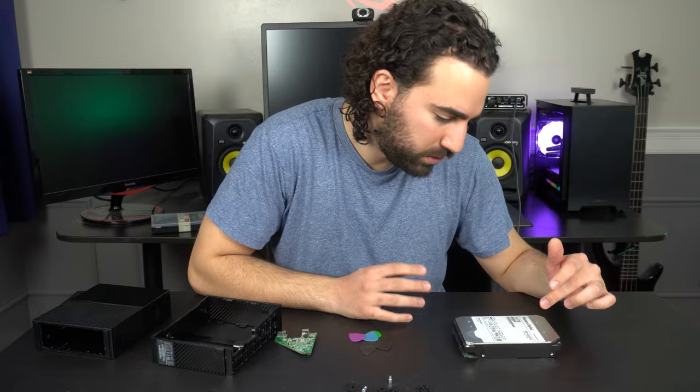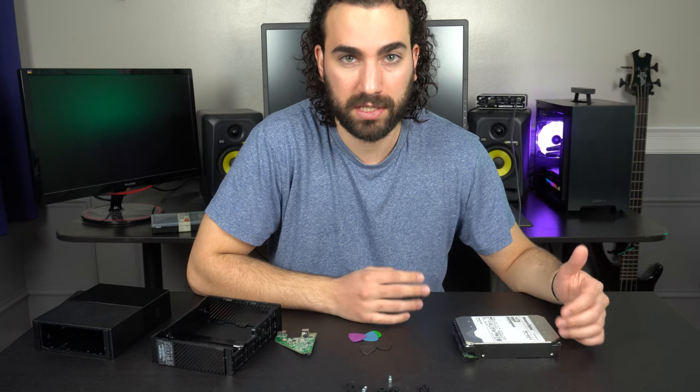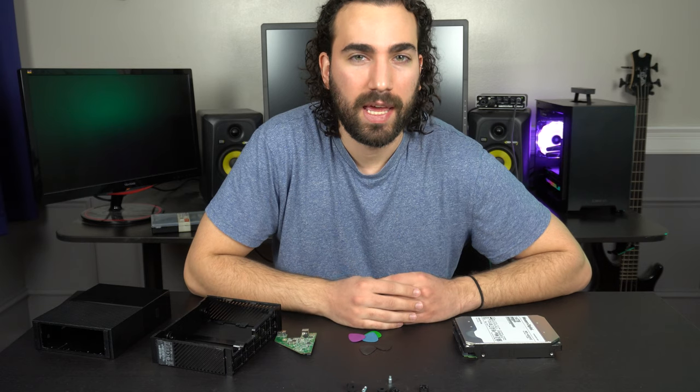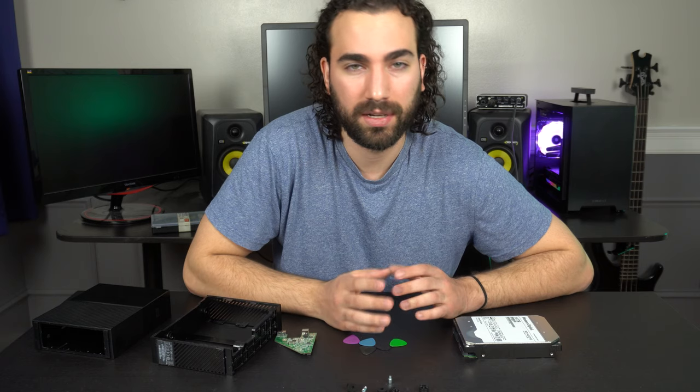The drive is the WD-140EDFZ. From what I know, this should be the exact same specs as the Red drive — it just has a white label. I did see on a couple of videos that you actually have to modify the SATA plug, because there's a 3.3 volt pin that basically shorts your drive so it won't be able to turn on. You need a specific cable or hard drive enclosure for it to work. I'm going to check if I have to do that on my setup and go ahead and start installing it into the computer.